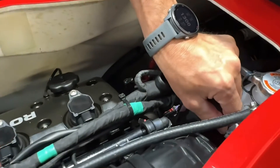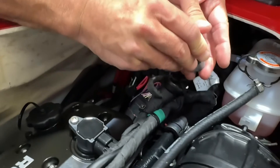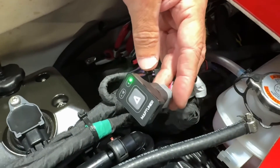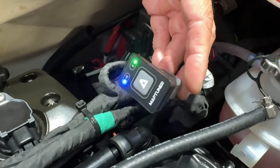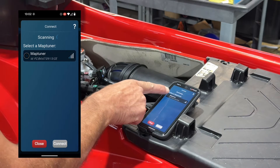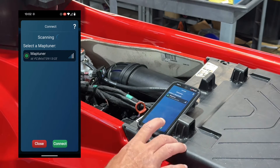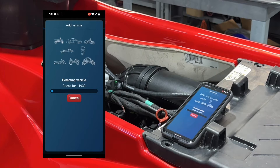Remove the diagnostic cable of your ski from the retainer and connect your Nano. Hold down the large button on the Nano until the blue light begins to flash. From the MapTuner section of MyMapTuner, select Connect. Select your Nano and MyMapTuner will connect. Now select Add Vehicle. Select Yes, then Yes again. MyMapTuner will upload the vehicle's information to your phone.